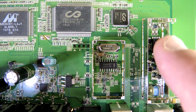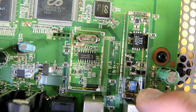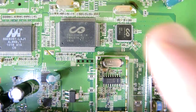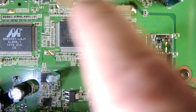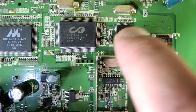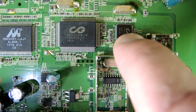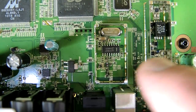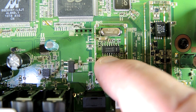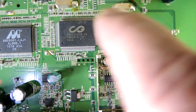Cans off. This is the RF in and this is the RF out. RF in looks pretty straightforward — there's an inductor here, some discretes, and probably a matching transformer. That appears to go off to a series of three chips in a row. I can't find any datasheets on the internet for these particular parts, so absolutely great choices for decap. RF out also has another integrated circuit right next to a crystal, and I can't find datasheets on those parts either.